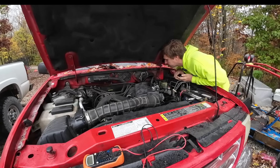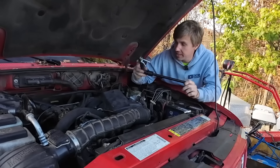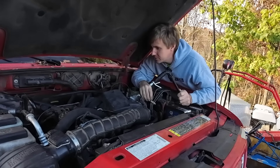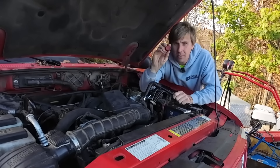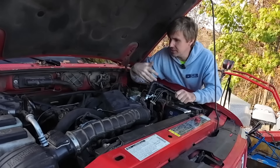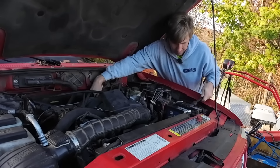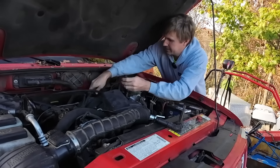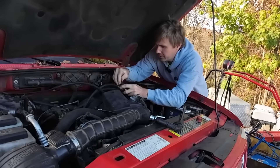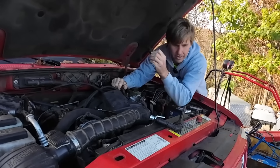Just looking some things over — this doesn't look right back here. So it's a few days later and I've got a new one of these. This is the PCV valve — positive crankcase ventilation valve. I'm not 100% sure this is what's causing our high idle, but it doesn't exist on this engine — it's not here. There's just a plug that the junkyard would have put on the engine. Normally with junkyard engines they cap everything, but that plug being on there tells me it wasn't there when they got it. And when I pulled the old one out, it rattles a little bit. It's old, all the hosing is dry rot, cracked, and in some places just flat out non-existent.